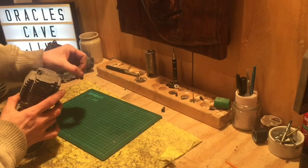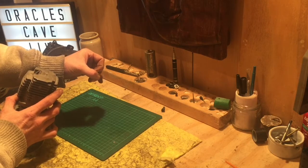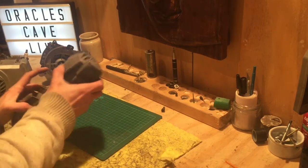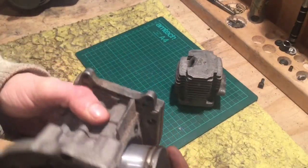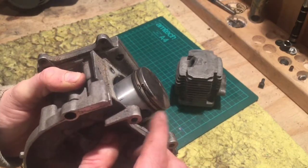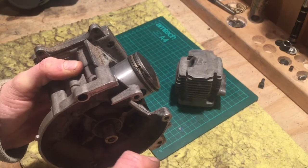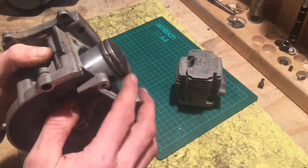When this head is on, there are two rings that are like spring rings — they're squeezed tight inside a tube. So when you pop off the head the springs want to just expand out a bit. These are your rings. As wide as they look and as much as they stick out, these can wear away — that's what they're designed to do. So when these wear away you could be riding your bike and it's going fine, and as it starts to heat up your bike starts to die. That's a telltale sign of these things going.